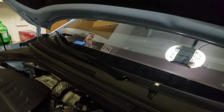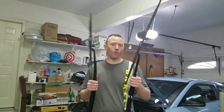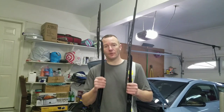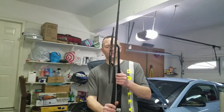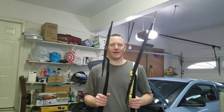This one's gonna be a little different. How do I know which side this one goes on? Well, you can mark it left or right for driver's side or passenger's side. But the rule of thumb is - not on all cars, but most cars - your driver's side windshield wiper is gonna be a lot longer than your passenger side. As you can tell, this one's got about 10 inches on it - this is a 26 and this is a 16. So if you're doing it, just remember: bigger side goes on the driver's side, smaller guy on the passenger side.